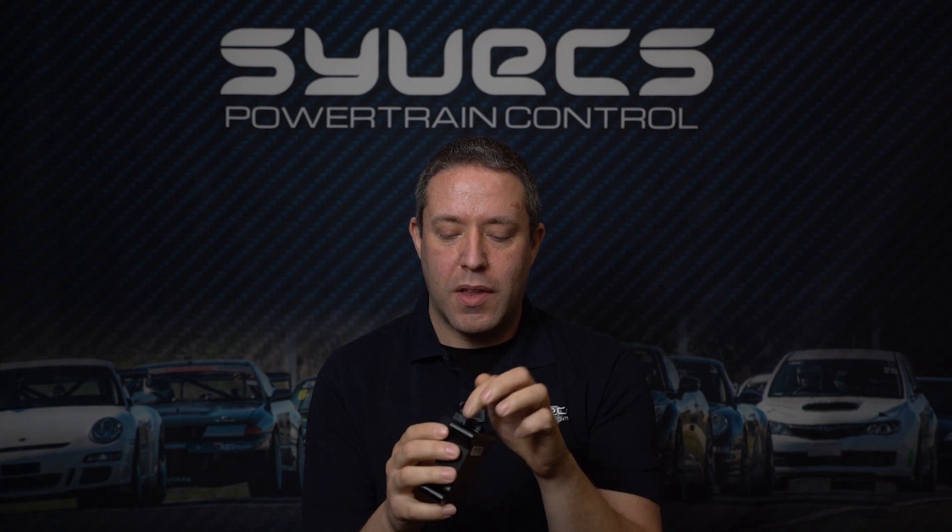You might see a slight change in the overall values. So what can you do? Quite simply, the cheapest and easiest way is to use EGT sensors. The sensors themselves aren't that expensive, and there are various products out there that allow you to run an EGT sensor per cylinder. This is a great thing to do — this is almost a crazy thing not to do if you're looking to optimize your engine. Why would you not want to know that all your cylinders are running equally? The easiest way to tell that is to measure the temperature of the gases leaving each cylinder. We have a product — the KT8. This little box connects to a CAN bus and allows you to run up to eight EGT sensors, streams it across CAN into our ECU or other ECUs, and allows you to very neatly, quickly and simply add multiple EGT sensors to your engine.